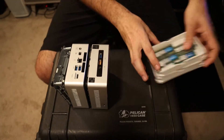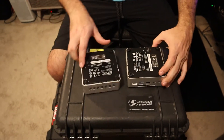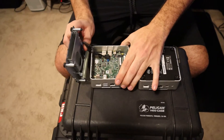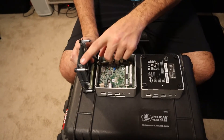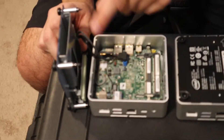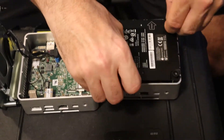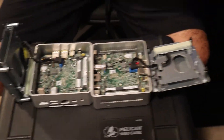Alright, we're going to move this out of the way, lay these down — you want to remember the fronts. Go ahead and unscrew all four screws here. We're going to open them up. You only need this bracket if you're going to be doing a solid state drive or a regular spinning drive. We've got the M.2 drive so we're going to be loading these up right in here, then the memory stick. Same thing for this one — four screws — just pop this off and let's go ahead and load our memory in.